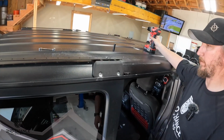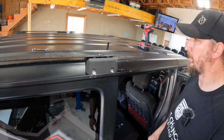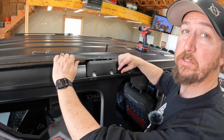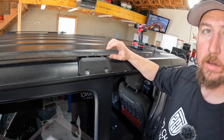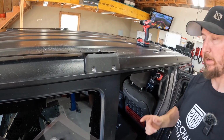And if you're ever drilling through fiberglass and the bit's got a little too much bite, you can run the bit in backwards, in reverse. That's a good tip. So now we just need to pull it up, silicone it, and get it bolted into place, right? Yes, sir. All right, so we'll do that next. We'll get this cleaned up, get it siliconed, and make it happen.